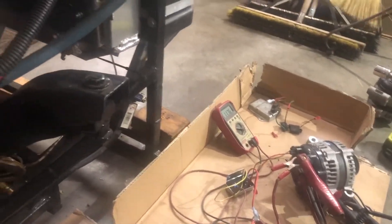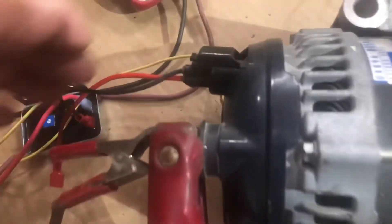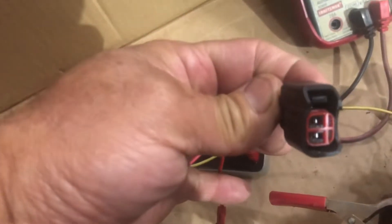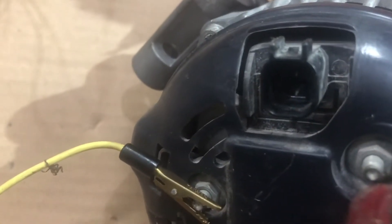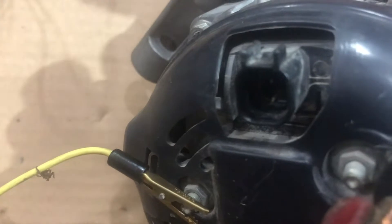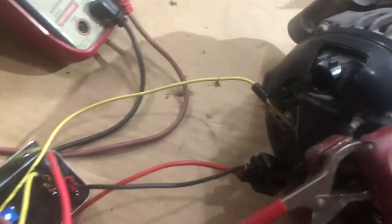Here's the first style — this is the plug that looks like an injector plug. If you look at the plug it looks like an injector, this is the new style. This is the Type B. See that plug? So the pins are up and down: your top pin is your field, your bottom pin is your sense.